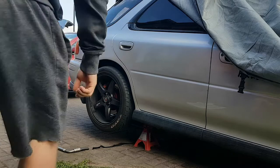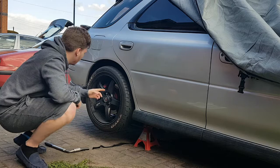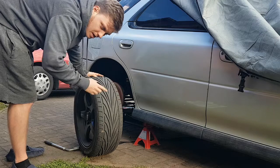This week I'm just doing a bit of work on the rear arch — a few stone chips and stuff. I've already ground it back to bare metal and coated it once with Dinitrol. Going to tidy it up, give it another quick blast of paint, then primer it and hit it with some 406 silver, which is what the other car is.